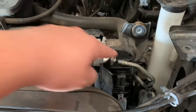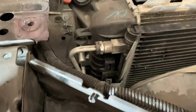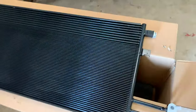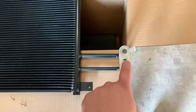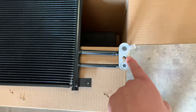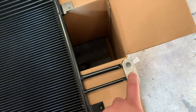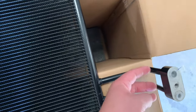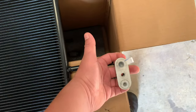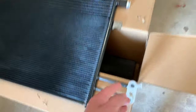Now that it's out, we move on to the other side. Taking off this side now — just like the other side we have another clip here, and we have two more bolts on the bottom. Like I said, we have this one clip left to do, and then down here where the AC lines connect there's going to be a 10 or 13 millimeter bolt — or actually a nut, because the new one comes with a stud, so you just have to take off the nut to put out the line. Where the lines pass through the radiator there's another little bracket that holds it, so there might be another 10 millimeter there.